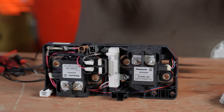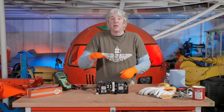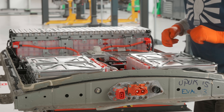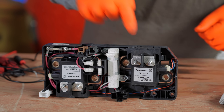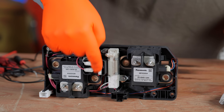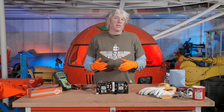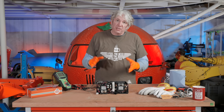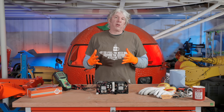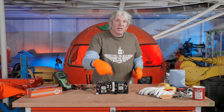In its normal environment, you'd have all the batteries at one end, the fuse unit just there, and then the connector on the outside of the pack going to the inverter at the front of the vehicle. This is the negative contactor, then you've got the pre-charge contactor, the positive contactor, and that white thing there is the resistor — it's designed to ease the electrons into the inverter rather than rushing in and arcing all over the place. This just slows that flow right down. It also discharges the system when you turn everything off to make it safer.